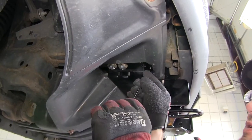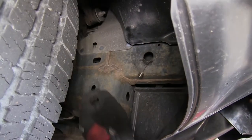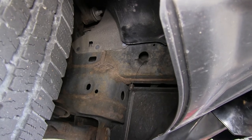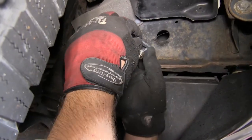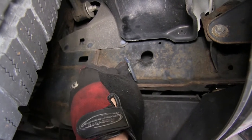To get our hardware into the frame, we'll use our pull wire to go through the attachment point and out the access hole further back in the side of the frame near the tire. Now with our pull wire out of the access hole, we can take our block and slide it onto the pull wire and then thread on our carriage bolt.